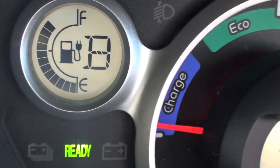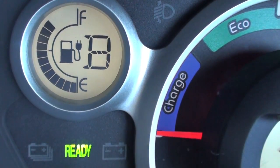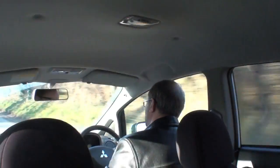As we gain speed we're moving further into the charging zone. We're on slightly worrying roads — a little bit icy. We're doing 22 miles an hour down the hill. I haven't touched the throttle since we started moving. The road gets very steep here. I may have to apply the brakes a little to maintain safe control. We're now doing 33 miles an hour. It's a little icy but we're fine. We're still going and we're charging like mad as we come down to the bottom of the hill.